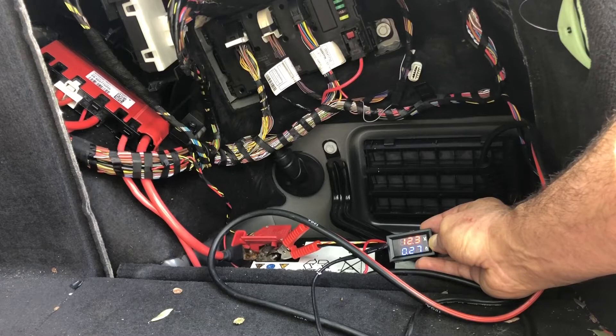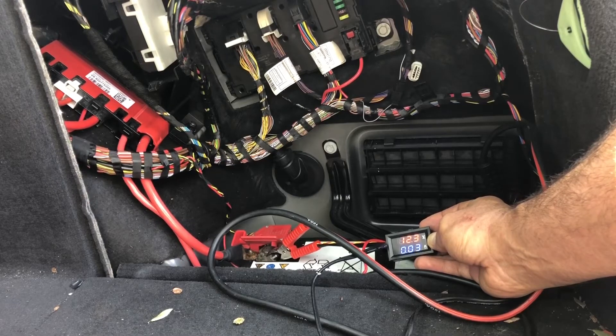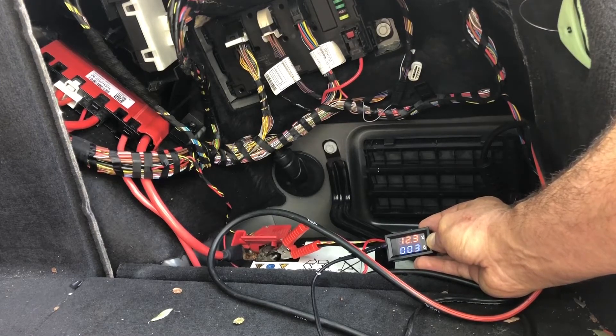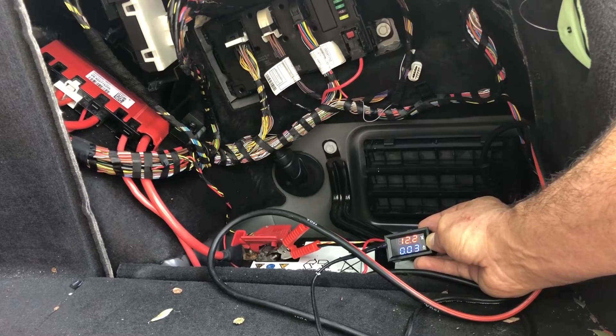It's dropping a little bit — all the units in the car are going to sleep mode. It dropped pretty quick. It's already 40 milliamps, which is pretty good. It can't be zero of course, because all the modules have microcontrollers that stay on to remember the state of each module. It's already 20 milliamps, which is really, really good — the car is doing well. It goes to sleep properly and is not draining the battery.